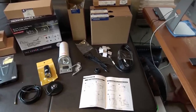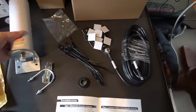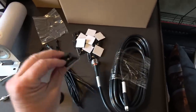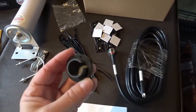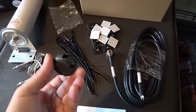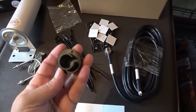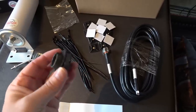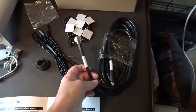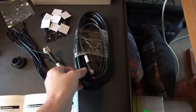So let's go through the pieces. There's your rooftop antenna, which comes with a U-clamp to go around a pole or a ladder. You get some zip ties and 3M sticky things for running the cable around. This piece is to go through the wall of the RV — you drill a one-inch hole in the side and run the cable through. I'm not going to do that since I already have the existing wire run through a junction box on my roof. They include all the pieces to do it though. And then here's your external cable that goes on to the antenna and runs inside to connect to the amplifier — looks like pretty thick, decent outdoor cable.